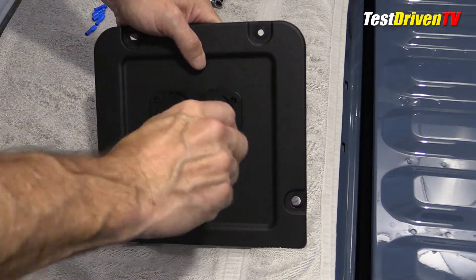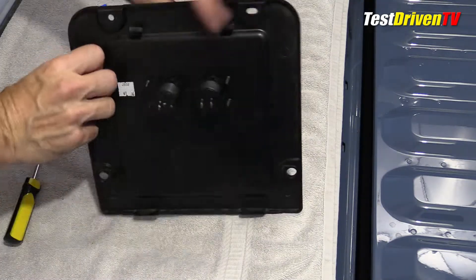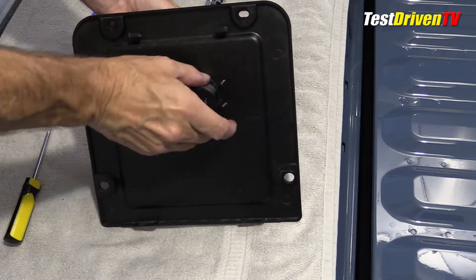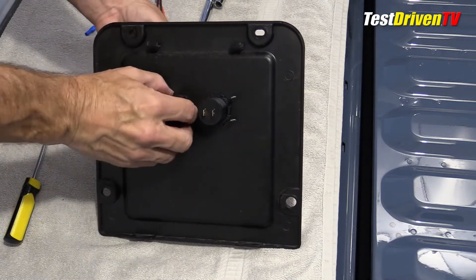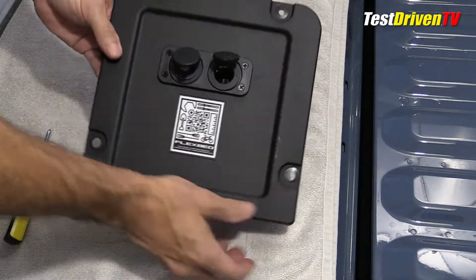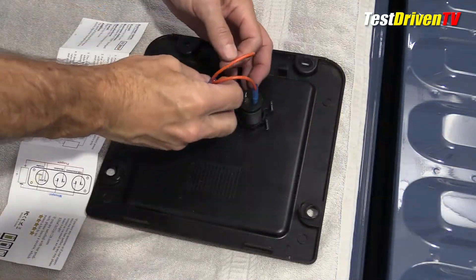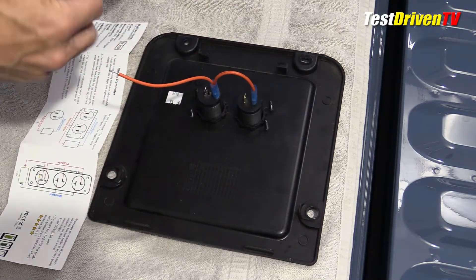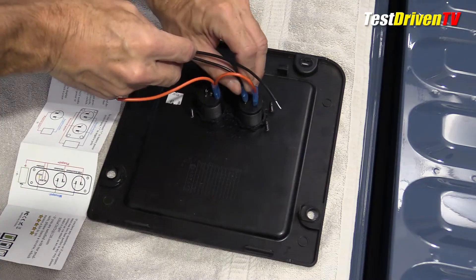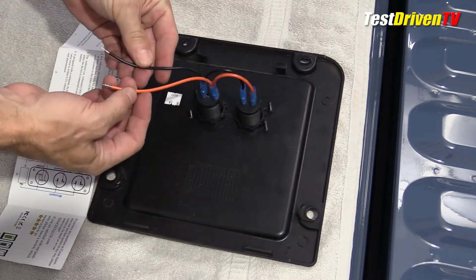The included small panel is not necessary to install the two round outlets, but it gives a more finished look. Installation was quick and easy — slipping the two outlets through the panel and the access cover and securing them tight with the twist nuts and then the four mounting screws. Instructions came for the wiring along with pre-made wiring harnesses and a collection of connectors. I had a few extra as well as a crimping tool to get it all put together and then connected to the 12-volt power source.